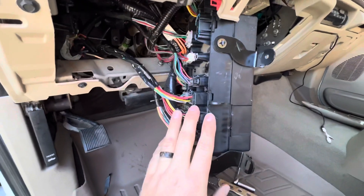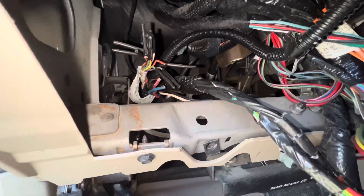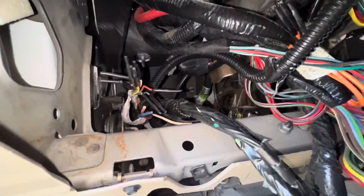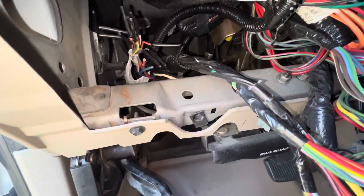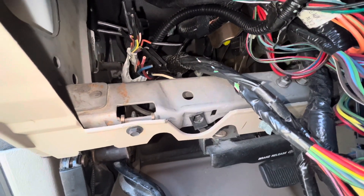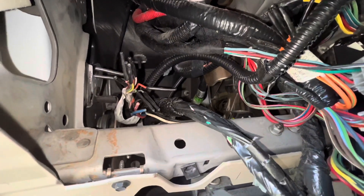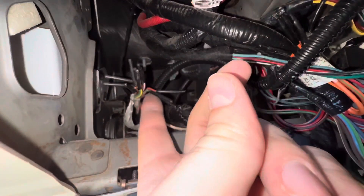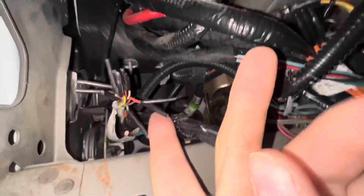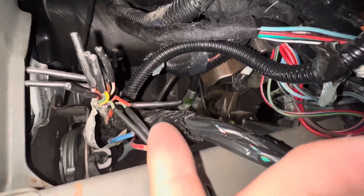Once you've got this guy set down, kind of pull it to the right here — it seems to make it easiest. As you can see, there's not a whole lot of room to work with back here. To start, there are a few wires you can connect to. I will put the full install description in the description below so you can see which wire works best for your application. For the most part, for your average application — getting the heater warm faster, keeping your AC cold, or jump-starting for a higher idle — you're going to want to find what I believe is called the BCP wire, which is going to be purple with light green. You can see it's the one on my fingers right here. Don't get it mixed up with the green with purple — you want the purple wire with the green line.